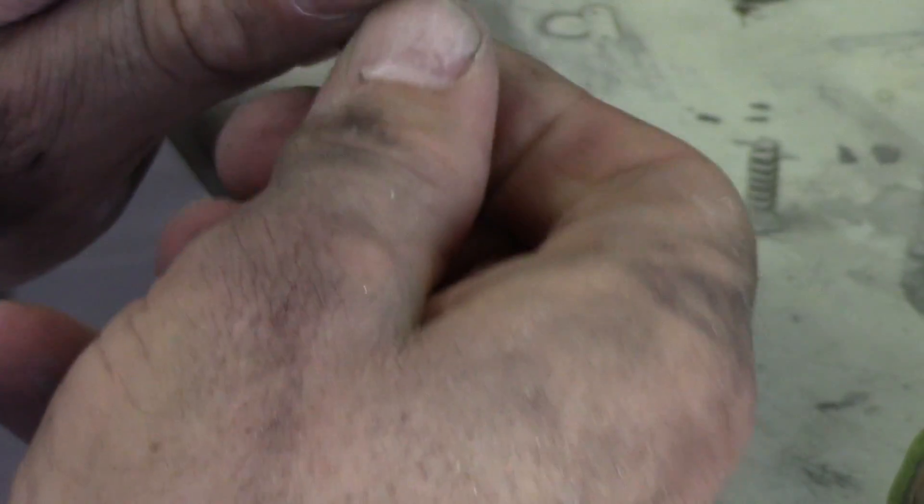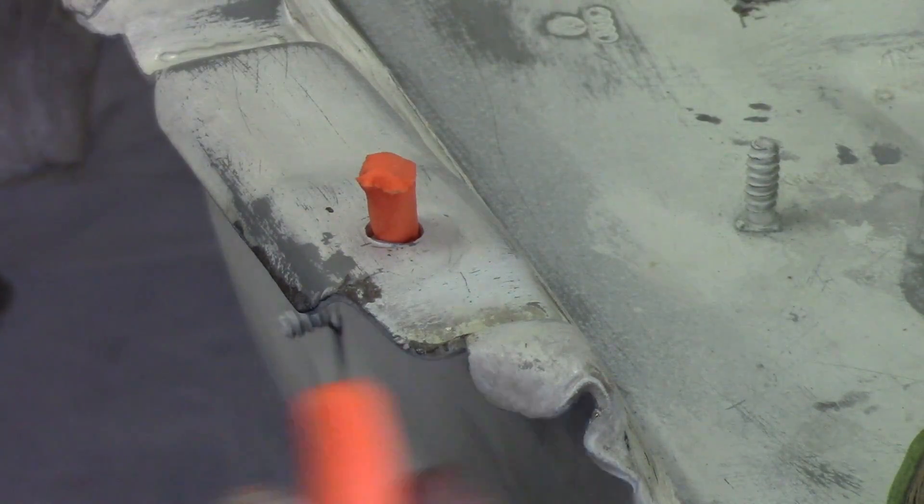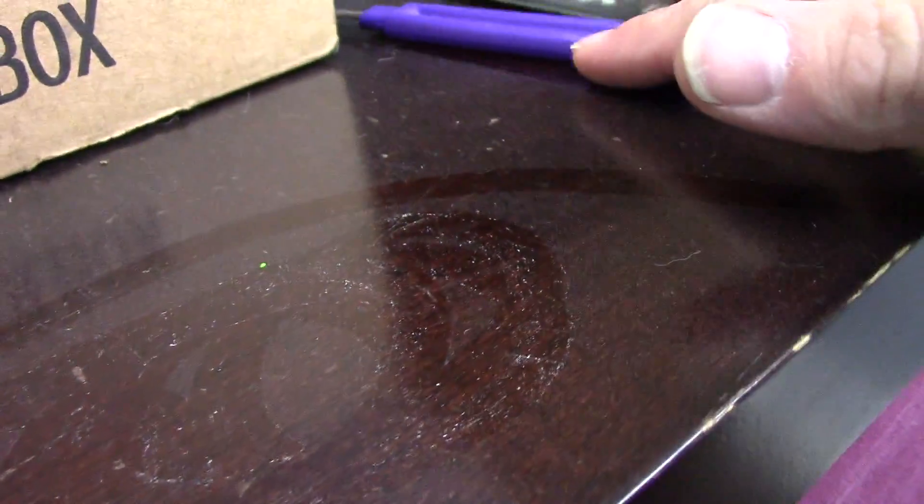If you have any bolt holes or things like that, a really great trick is to roll up a foam ear plug and shove it down in the hole to let it expand and fill that hole. The further in you get the ear plug, the more likely you'll be able to get an even coat of paint, so make sure it's down as far as it'll go. Also, if there's anything else in the garage you don't want paint on, make sure you cover it. This table is about 15 or 16 feet away from where we were painting and it still got paint dust on it.